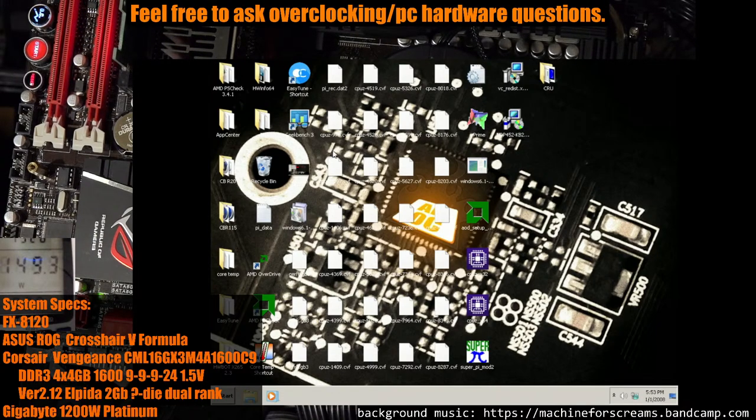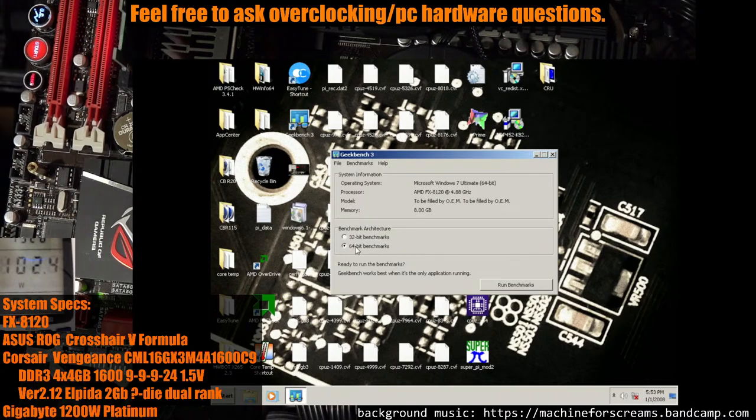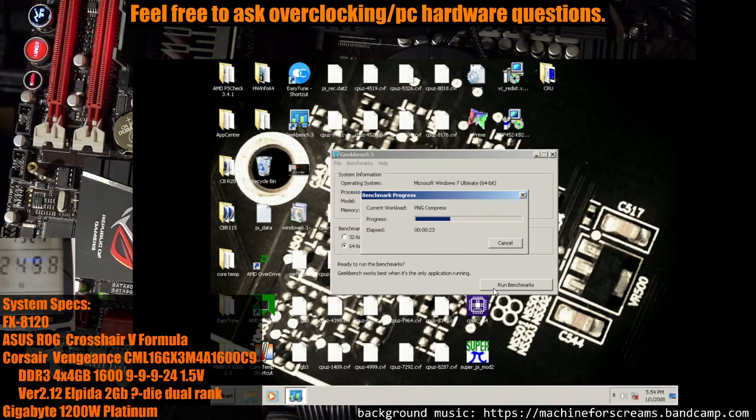Yeah, so it does do 997. I wonder if it does 996. That would actually be kinda wild if it did 996. Though, actually, does the BIOS have a TRC register? Or does the CPU have a TRC register? Because this could be one of those AMD memory controller things where if you don't lower TRAS and TRP, then, no, not TRP, but TRC, and TRP might not do anything. Actually, no, that doesn't make sense because TRP is always used. It's TRAS that sometimes can get ignored.